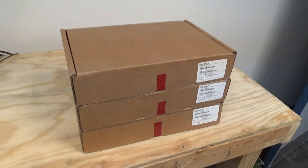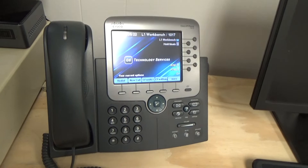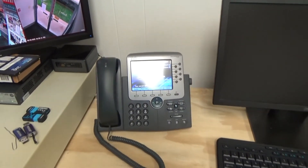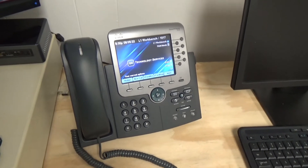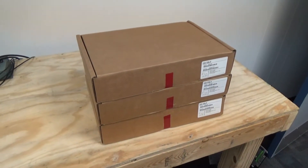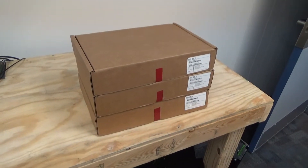These are all the same model. They are the Cisco 7975G. It's got a nice color touchscreen, which is good. I was able to get this working with FreePBX and Chan SCCP because they ship with the SCCP firmware. You can find the SIP firmware online, but I try to avoid sketchy downloads from places I don't trust and I don't have a support agreement to get it through Cisco. I did try it but it ends up working better in SCCP mode — there were just some weird little glitches with the SIP firmware.